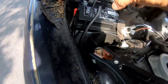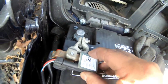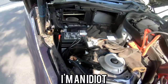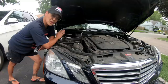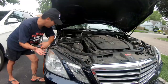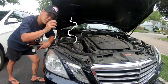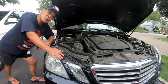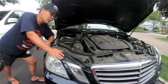For some reason this is not reaching the plug — it's off by a couple of inches. I don't know why, it's exactly the same position. Something as simple as changing a battery was not that simple. I put the negative on the positive and the positive on the negative, and as a result there was a jolt. Before I realized what I did it was too late — now my navigation, my screen, and my windshield wipers don't work. I looked through all the fuses in every compartment and I can't find it.